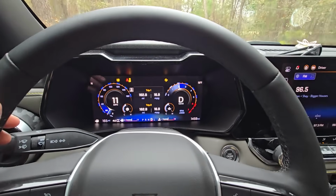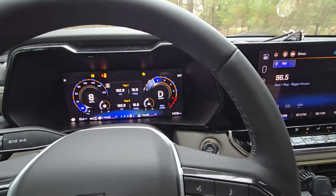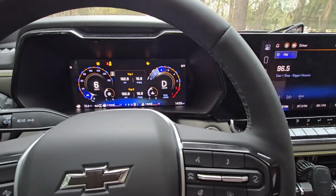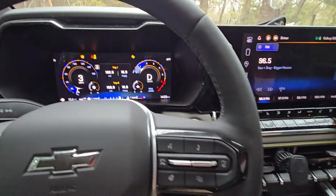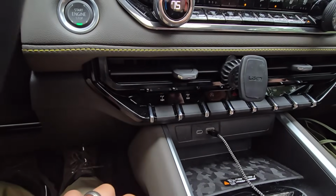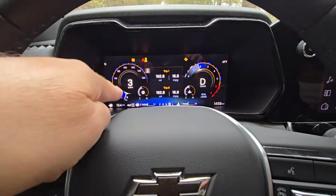So now what we're gonna do is we're gonna come to a stop. We don't actually have to in this one. Some do. Sometimes you do, sometimes you don't. In your Toyota, especially your Nissans, you're gonna have to come to a stop like this, okay? And you're gonna have to engage your rear one first. Rear locker, it's going to engage. Rear locker is engaged.